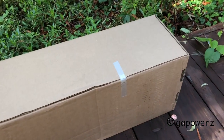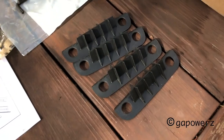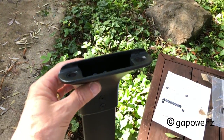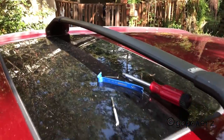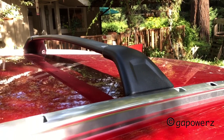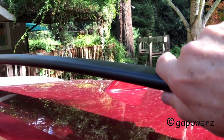Before I tighten down the left-hand roof rail, let's take a look at the crossbars. Here's what we get in the box: front and rear crossbars with end brackets pre-mounted, some isolator pads that all seem identical, and some bolts plus a free Allen wrench. The sticker tells you which is front/rear and left/right — FR. Here's the isolator pad placed loosely, with the holes in the brackets fitting around the mounting holes. The rear bar's bracket slopes more on the rear edge, and the crossbar is a little blunter on the forward edge, like an airplane wing.